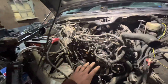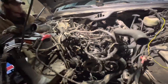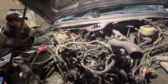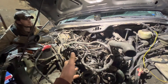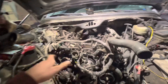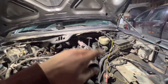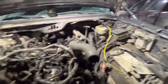I had a situation earlier this year — last year at this point — where I was driving this truck around the week or two after I bought it. It was losing coolant for some reason and I decided to put a new cap on it, but it was off a semi truck. On semi trucks the fill cap for the coolant is different from the breather cap. On the 6.0, they just have a reservoir tank with a spring on the cap so it purges at a certain pressure. I put a sealed semi cap on it and blew out the radiator.